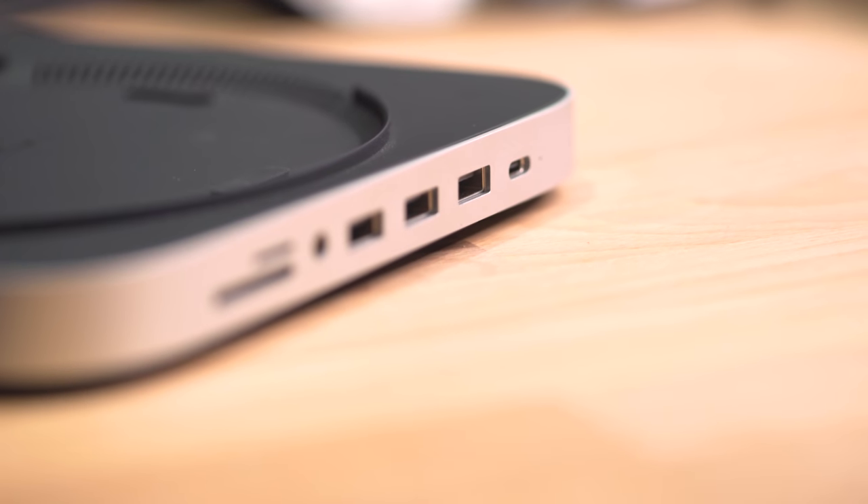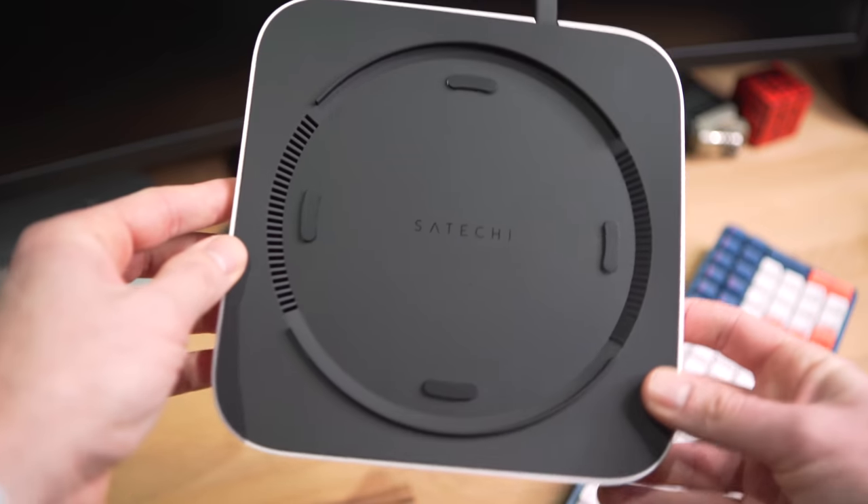I really like the Satechi. It gives you those ports on the front, including a USB-C port, but it's important to remember that isn't an additional USB-C - it's actually just an extension of one of the USB-C ports on the back of your Mac Mini. That can be a downside because the transfer speed of the Satechi's USB-C port is nowhere near as fast as what you get directly at the back of the Mac Mini. I've done fairly quick file transfers on it, but it's not the same thing. For some people, losing that direct USB-C connection on the back isn't ideal. If you just want quick front access and don't mind losing some transfer speed, it's great. But if you really rely heavily on the USB-C transfer speed at the back, it's probably not ideal to go for the Satechi.